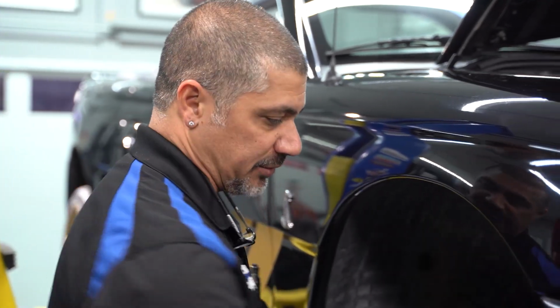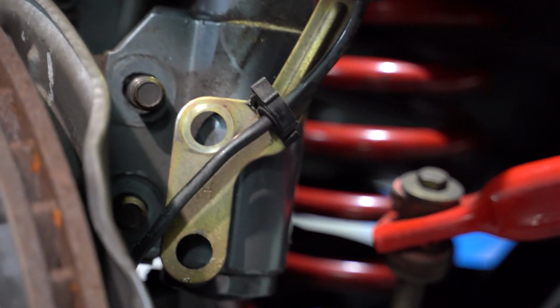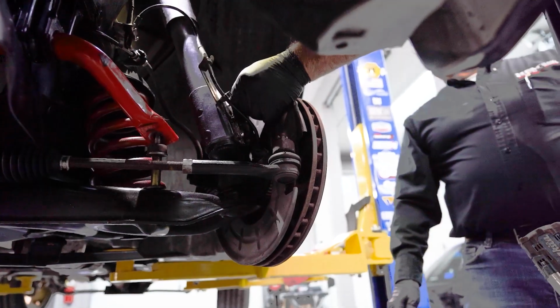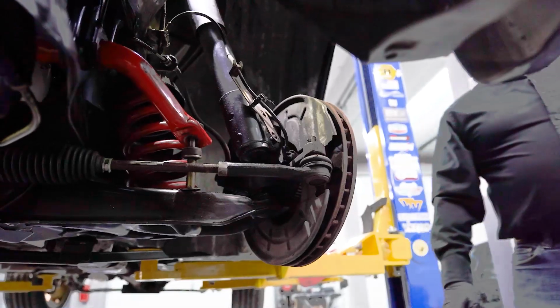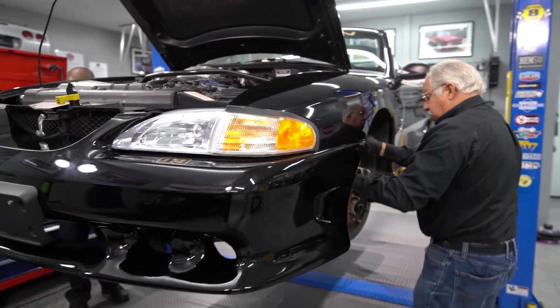So when you guys take apart the front end, you have to be careful not to put too much tension on the sway bar or not to remove those 2 bolts because that spring could come knocking out of the perch. So we can put a jack up under it, or we can leave the sway bar attached, change out the strut, then go back and change out the sway bar bushings.